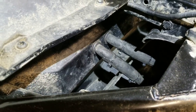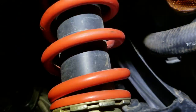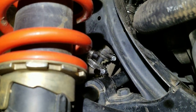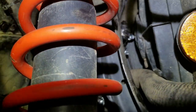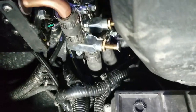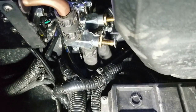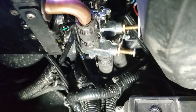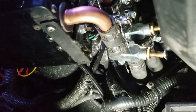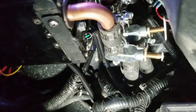We got it all plumbed in - there are hoses coming through the firewall. We put tees in: one on the lower radiator hose and one on the upper radiator hose back behind there, then coming into the cab with two shutoffs - one on each side. I'm putting shutoffs on both sides because if I have a problem with the heater core out on the trails I want to be able to completely isolate it.